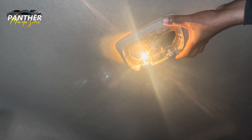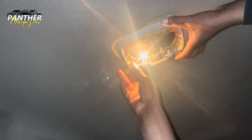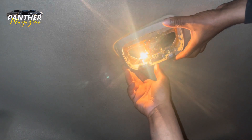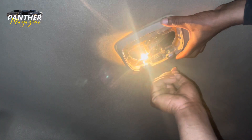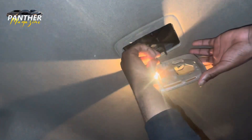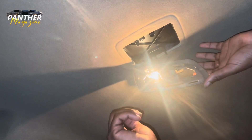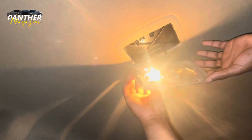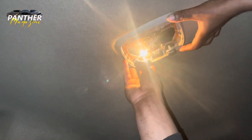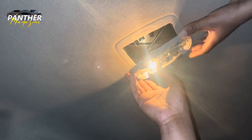So I'm just going to have to find a 2003 dome light console off eBay - something that shouldn't be too expensive. I mean, it cost me $5 at the junkyard this morning. But that's pretty much how you would swap this out if you ever wanted to: there are three screws you have to take out, this will fall out and hang from the connector, you're going to take the connector out, grab your new console, put it up, connect it, put your bulbs in and it should work. And that's about it. Thanks for checking out the video - I'll let you guys know when I get a new dome cover. I'll catch you guys on the next video. Thank you.